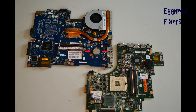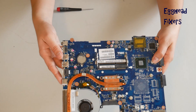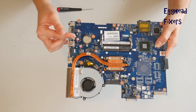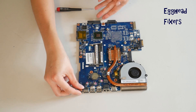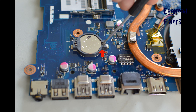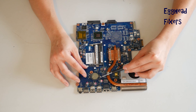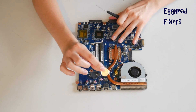Now for the cradle kind of CMOS battery. Cradles vary drastically from model to model. This is the most common kind, so we'll demonstrate on that. But if your cradle looks different, you may have to adjust the way you do it — sometimes there's a flap or a piece of metal you have to move. For this kind, you take the screwdriver, set it there, and push it to the left gently, being careful not to break the cradle, as it's very hard to fix once broken.